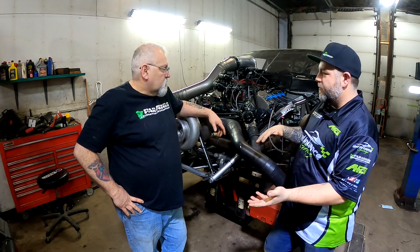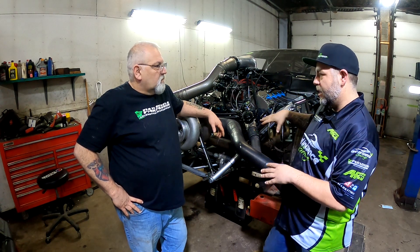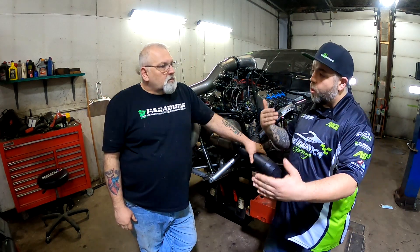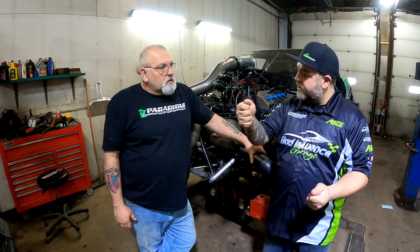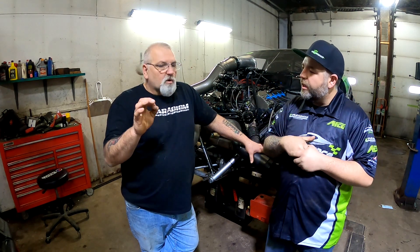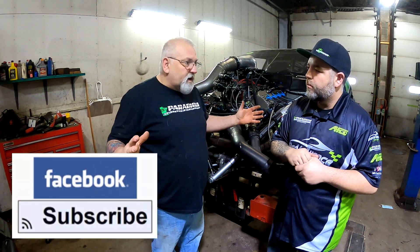We re-rolled everything and changed the caster and camber to make sure they match cross from left to right side. If you run more caster, the steering wheel comes back to center quicker, but it also makes your steering more touchy and crisp. Caster is also looked at in relation to total wheelbase — the longer your wheelbase, the easier it is to control the car going down the track. That's why you see fox body Mustangs, which are shorter, reacting quicker, while pro mods at 114–115 inch wheelbase are easier to drive.